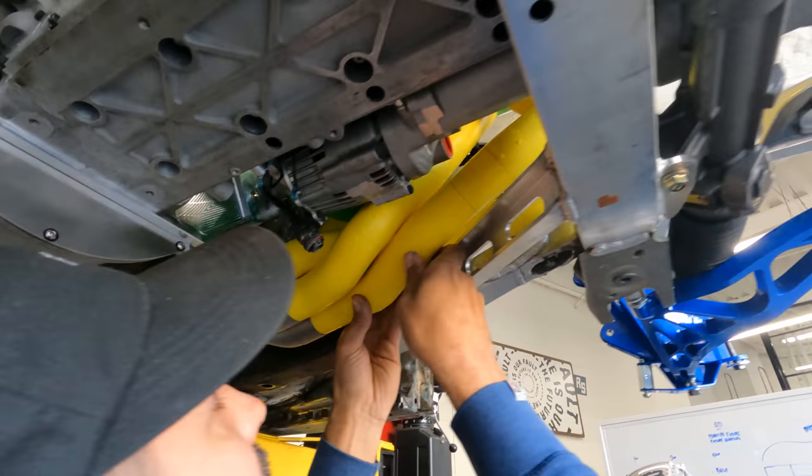Let me show you guys all the work that Dom put into this thing. So since the steering rack is offset to this side, we had to make a big spacer, which Dom made out of chromoly here, put a nice hex on it, turned it down as much as possible since it's chromoly, it's a little bit heavy. We're using Mark V Supra tie rods. And then to tie everything together, we're using a 5/8 heim joint, 5/8 threads, and I think this is M14 1.5. This 7075 aluminum came out really nice, and then this side we're using the Wise Fab spacer that Dom had to turn down a little bit to get the proper length out of this. Another steering arm here, everything's tied in, man.